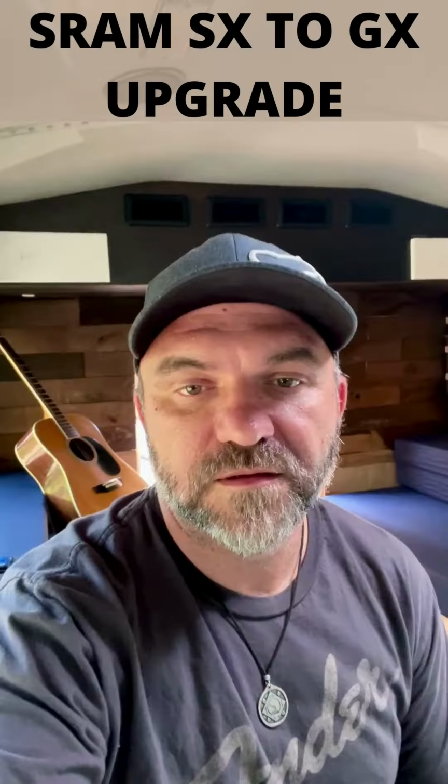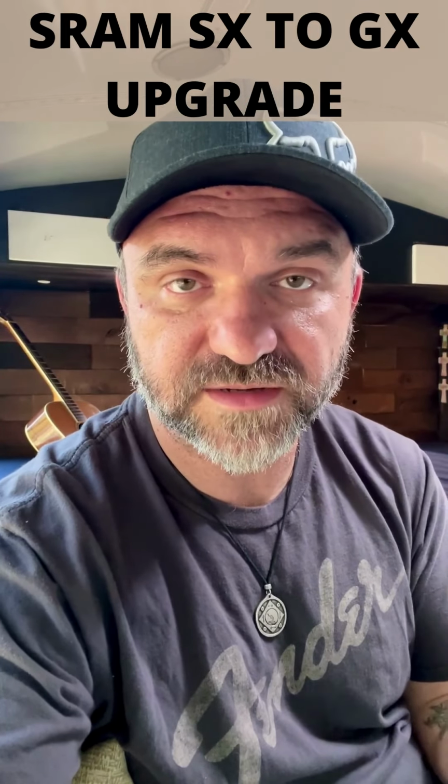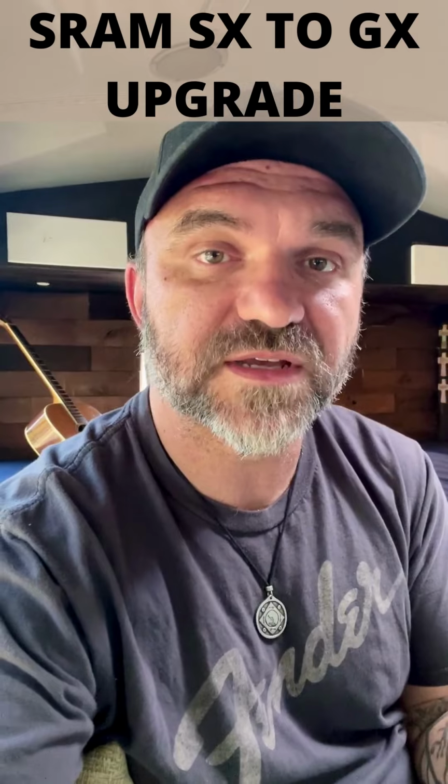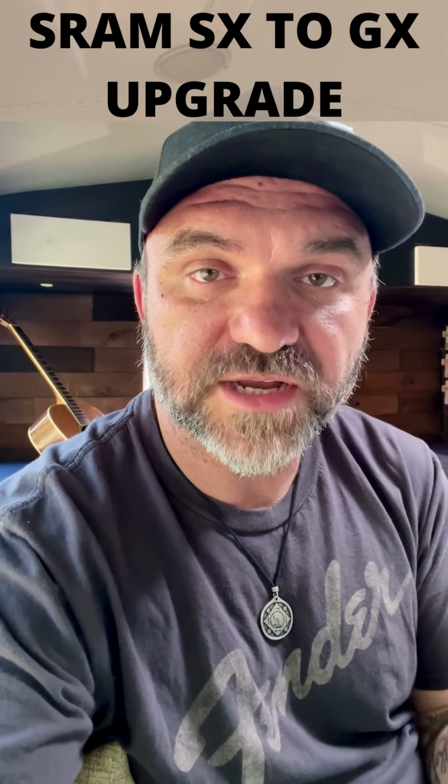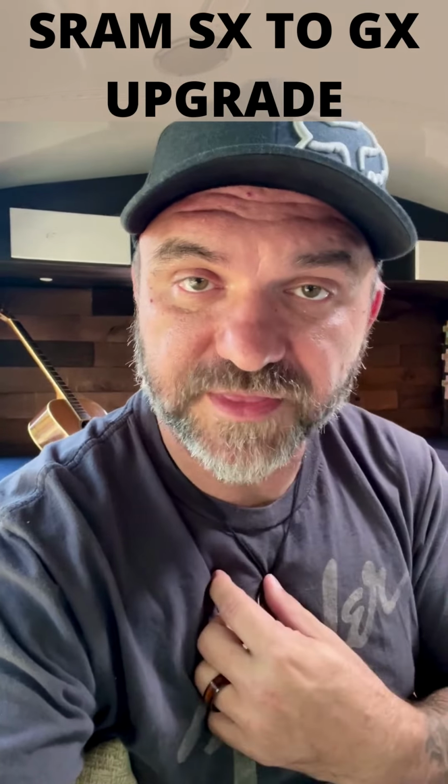Number two, crankset. Seems like it should be super simple. It's really important you know a few things that I didn't know. One, what kind of bike you have, so threaded, pressed, etc. Plus if you're going to need a boost or non-boost for your crankset. Now that may be specific to certain bikes or certain cranksets, but the offset of the chainring matters. I got the non-boosted crankset, needed the boosted crankset. I had to send the whole group set back, bought a new one, having that shipped out today.